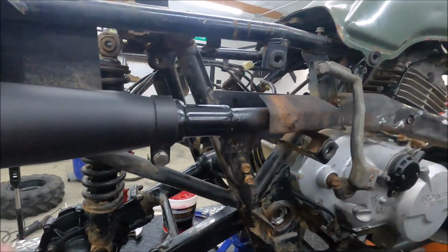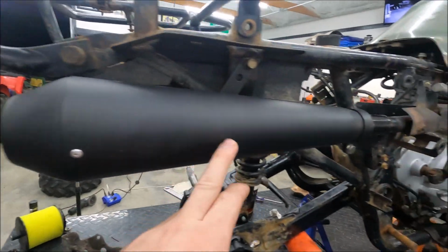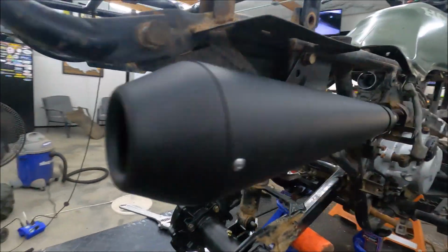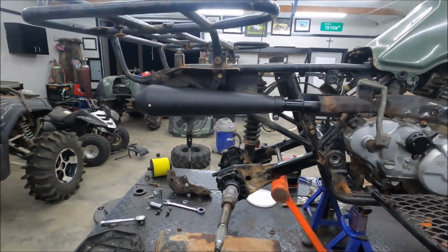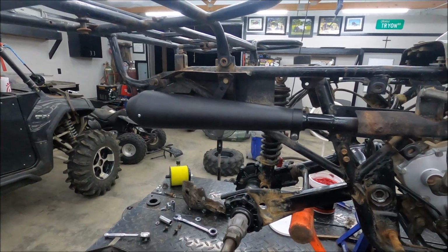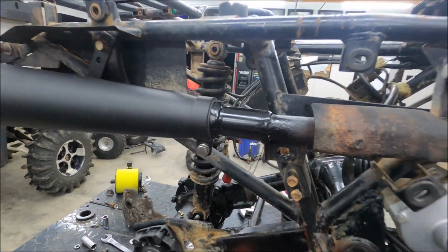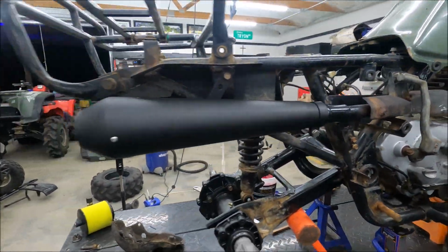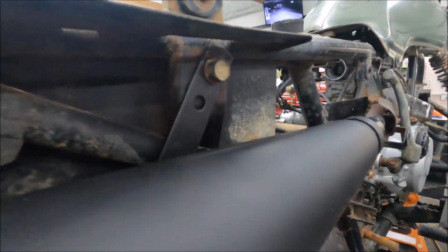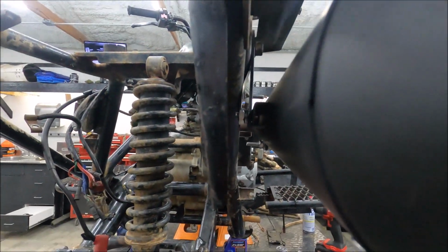And this is actually the diameter of the whole pipe inside. So the only place that is not solid from here on back is just right here, which is riveted on. Like I said, in there, it's all the way through. It should sound a whole lot better than the Tractor Supply FO4s and everything, because it is actually a muffler with packing. It's not just metal baffles. Just got to get a couple of reducers there, I got those from ABC, but O'Reilly's, all those places are the same. It even comes with the little mount there already, fully adjustable, on that rack right there.